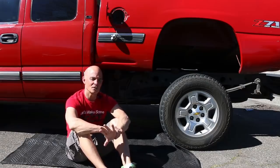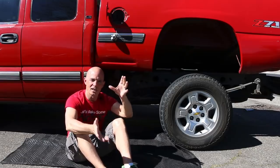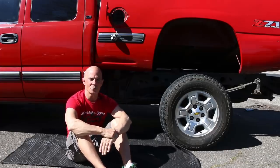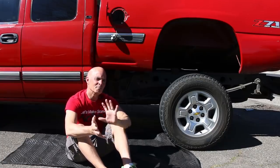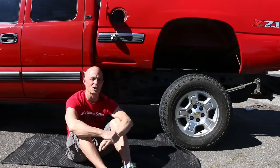A positive displacement supercharger provides a fixed amount of air for every revolution, moving it from one side to the other, so it has to be sized to move a given amount of air relative to the motor. That supercharger was sized by Eaton for that combination for GM to move a certain amount of air. That motor was rated at 240 horsepower and made about 7 or 8 pounds of boost with that supercharger.